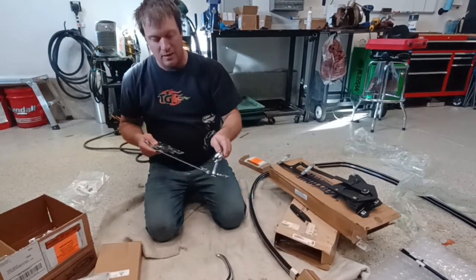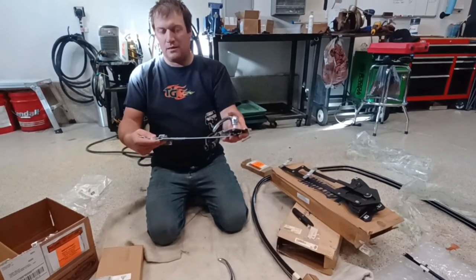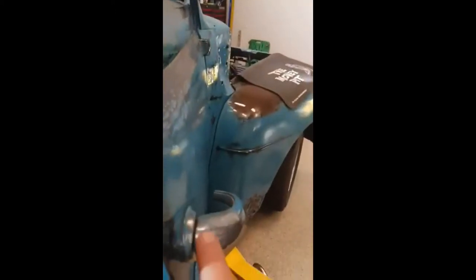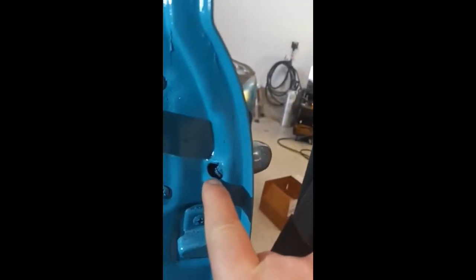So we are going to end up putting all this together and taking the old stuff out. We're going to start with taking the door handles off. So the outside handle, which in typical Ford fashion, they kind of sag and that's just annoying. To remove this door handle, there is a flathead screw right there that we have to take out.